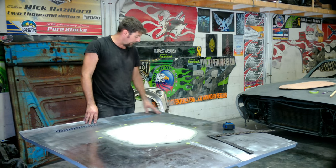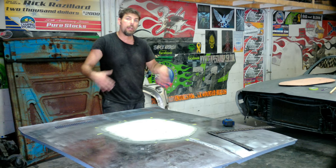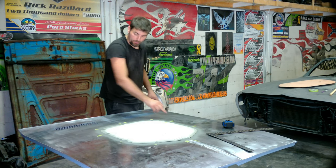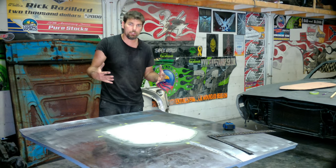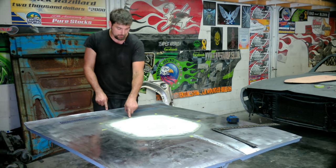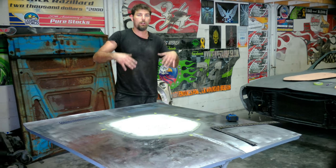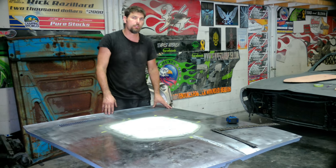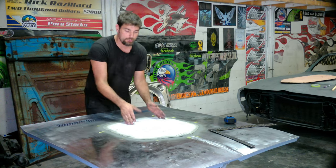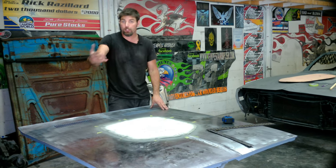Our hood didn't work out that way. I ended up with 28 and three-quarters and 28 and a quarter. I'm going to show you on the Golden Star hood that the ratio matched up with that hood too, so I don't know if this measurement is as important as the rest of them. If it's a little bit off, I don't think you freak out. Also, your center down here is 13 and a half inches. One more thing — the shaker hood is centered on the hood itself. If you ever look at your shaker car, they're off-center in the car — what they do is make the offset in the bottom base plate of the shaker to fix where the engine's going to be over to one side a little. That's so they can get the engine in there and the driver still has access to the gas pedal.